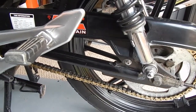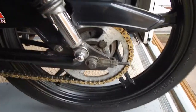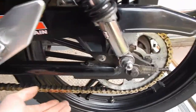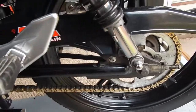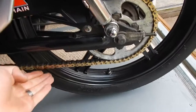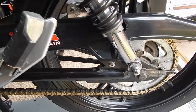Another thing not stated in the BOLTS acronym is the chain. Make sure it's in good condition, clean, and well lubricated, as well as your sprockets. On the sprockets, check the condition of the teeth — if they look like a shark's fin, it's time to replace. Rotate the chain round to make sure there are no stiff links and no excessive corrosion. If a link is stuck at an angle it won't travel over the sprocket correctly and could throw the chain off while riding — a potentially catastrophic event if it goes into your rear wheel. Keep your chain clean; you can buy brushes from motorcycle parts factors that hook around and clean it for you.